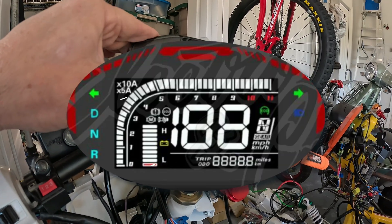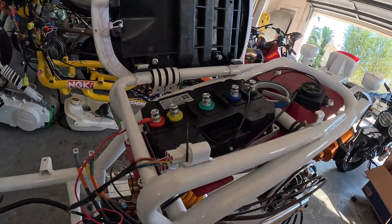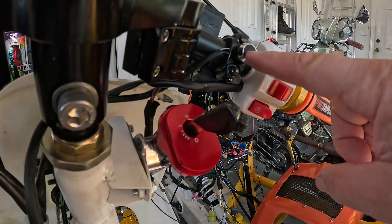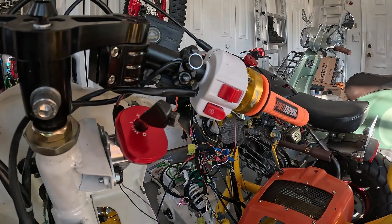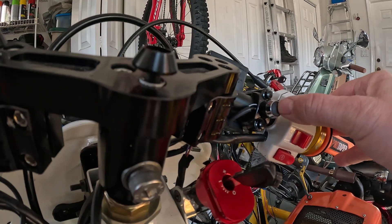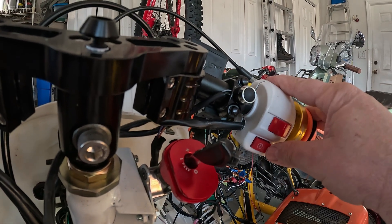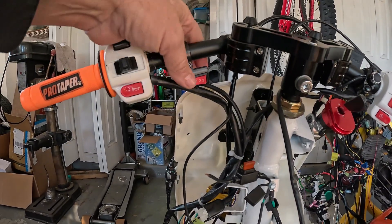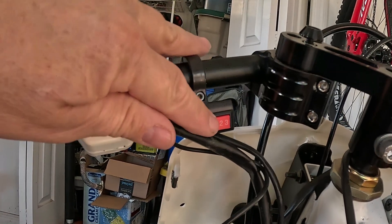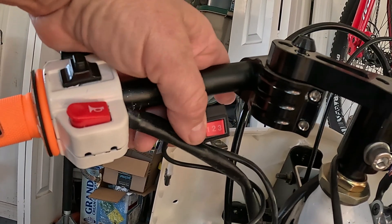It'll give you a little battery meter and tell you how full the battery is, how many volts you're putting out, how many amps, things like that. The third thing you want to power when you turn the key on is the controller itself. As far as buttons go, I'm going to have a button here for regenerative braking. Brake levers that work with regenerative braking - the back wheel on these things will actually slide, you can brake them so hard you almost don't even need rear brakes. I'm going to run a button so I have regular disc brakes in the back and use this for my regenerative braking. I'm going to use a start switch for my backup. These electric bikes will go in reverse, and then I have a one, two, and three power level - they call it a three-speed on these e-bikes. You go into the software and limit how much each level gives - three would be wide open. That way if you're trying to get good economy you can get there without killing your battery.